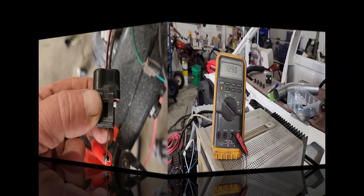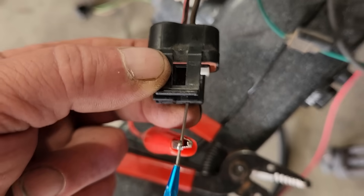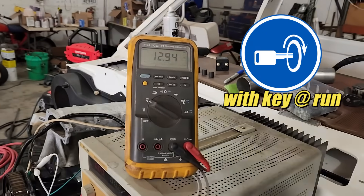The last circuit we need to check is for the alternator. This black wire from the Chevy harness will send 12 volts to the alternator. However, on this circuit, the 12 volts passes through a light bulb first. This is the exact circuit the Volkswagen alternator wants to see in order for it to work correctly — this is how a lot of older alternators with an internal regulator are wired to work. It just happens that the Chevy wiring harness is compatible with the VW alternator. Let's try this circuit. And yep, we get the 12 volts on the black wire.